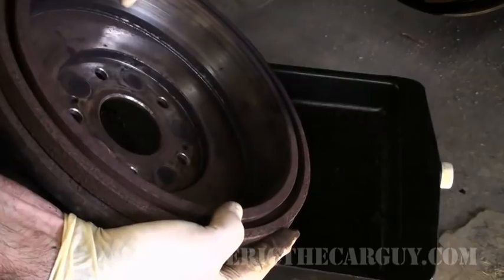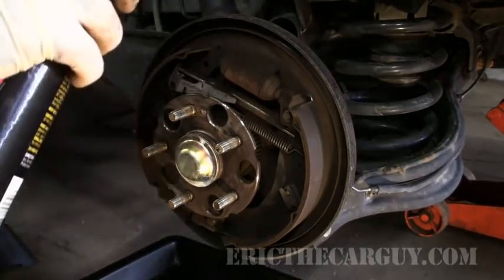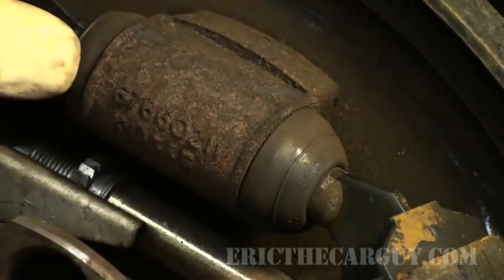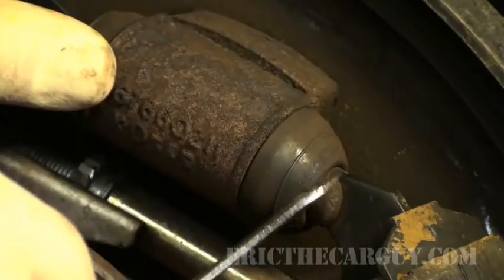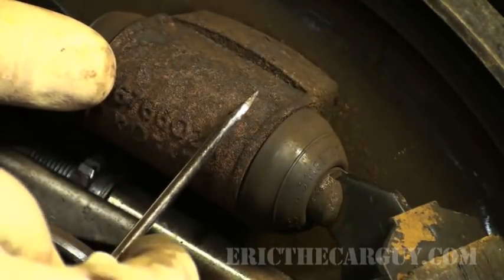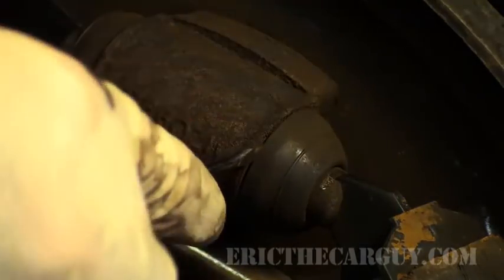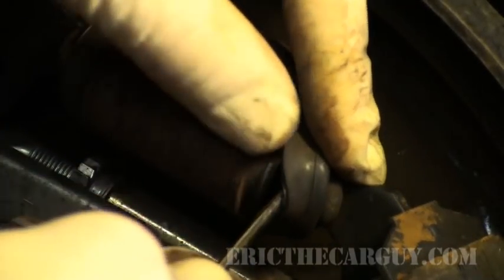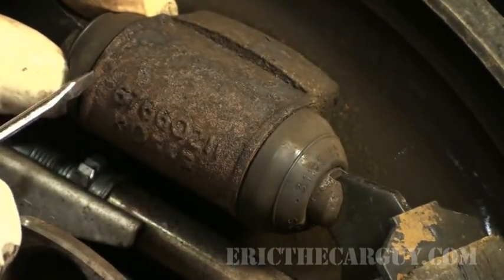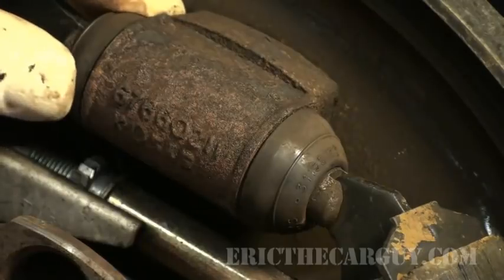If you don't have any pulsations, I recommend not doing anything — don't machine it, don't do anything. In fact, that's what Honda says to do: just renew the friction material. I'm now going to clean the area with brake cleaner. At this stage I like to check the wheel cylinders to see if there's any issue. This is the wheel cylinder — it's the hydraulic actuator for the brake shoes. As you step on the brake pedal, fluid forces these pistons against the shoes in both directions against the inside of the drum. I'll just take the screwdriver, go underneath this dust boot, and pull it back. If I don't see any fluid coming out, the wheel cylinder is okay. Check both sides, because there are two separate seals.